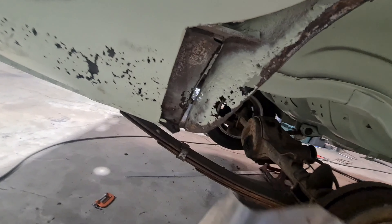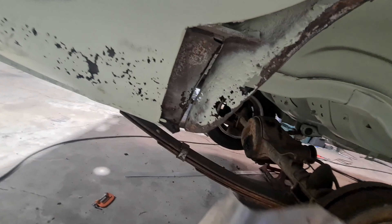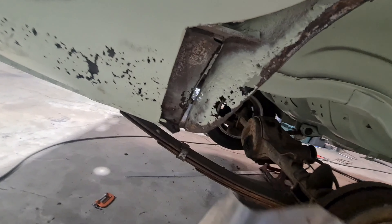The little wheel arch inner — one piece as well. And the quarter — one piece as well. Inner quarter and inner wheel arch just tacked in place, fitting good. Just got to fold up that little piece and spot it on. I'll have to remake this piece as well — same as the other side, it's all rotted underneath. Left it there as a reference for the jack holder but it's got to be remade. I've drilled some reference holes in the angle so I've got reference points when I remake it to spot it back on accurately.